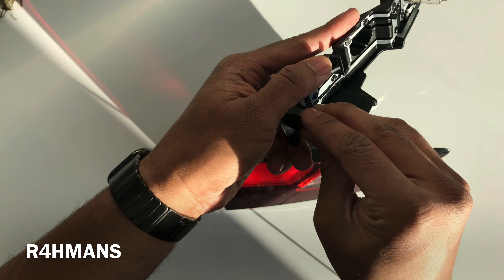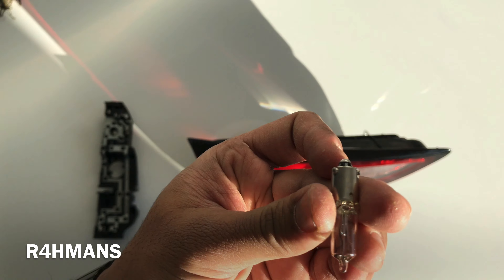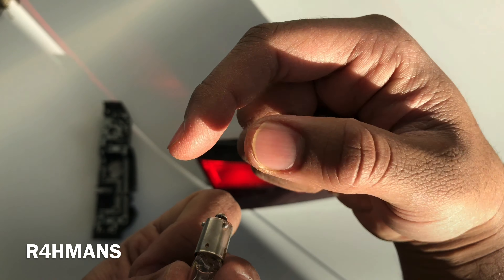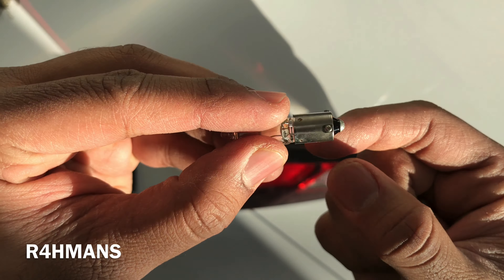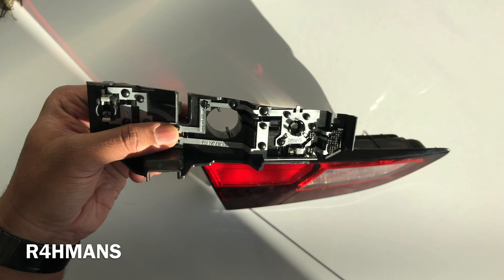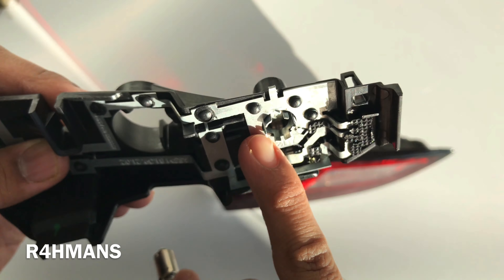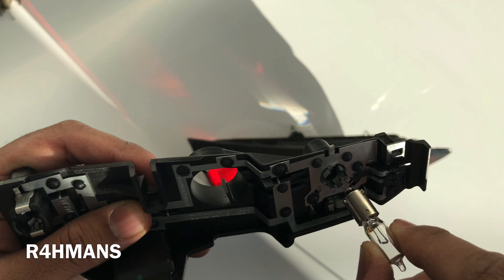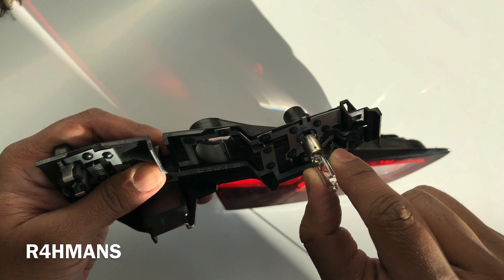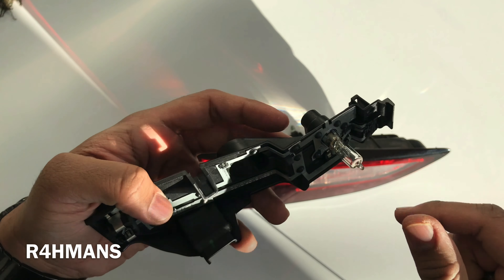The H21W you push in, twist to the left, then pull it out. This bulb looks like a bayonet but it's not — the two pins are positioned more on the top side. Make sure when you change it that it's the right way: if you can read the writing and it's not upside down, you're holding it correctly. Point the two pins into the top slots — right side and left side — and they should match up. If you put it the wrong way it shouldn't go in, but make sure you're using the two top slots.